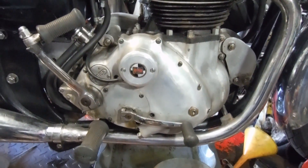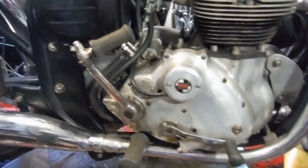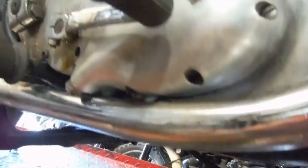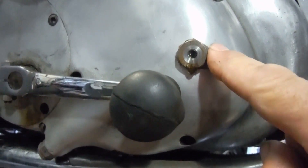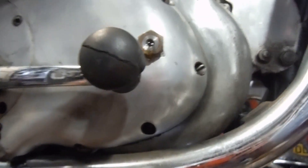The 300cc would suggest that an extra 100cc of oil got into the crankcase from the oil tank over the long weekend. So I had a look with the crankcase drain plug out and I could see occasional drips of oil — about every 30 seconds — coming from that area. Any oil going into the crankcase there must be going past the oil pump. I happen to know this here is a takeoff for measuring oil pressure at the end feed to the crankshaft after the oil pump, so I've taken the little check bolt out.